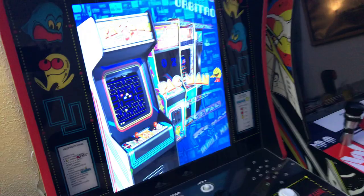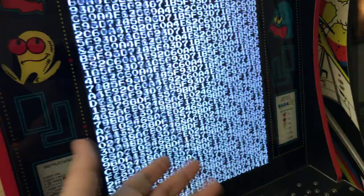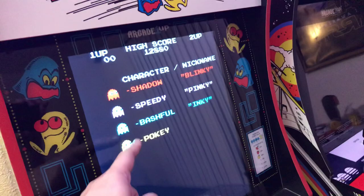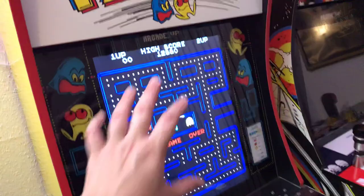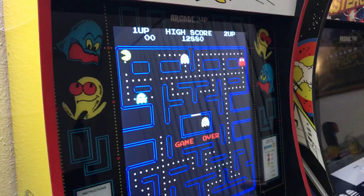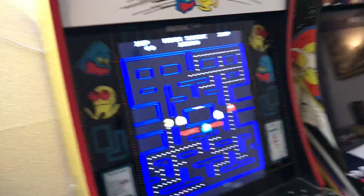Let me get focused — so if I come out here, there's the RetroPie. I'm using a vertical arcade set that you can find on Arcade Punks. It's specifically set up for vertical games from the get-go. One thing I'll warn you about — my monitor was upside down when I tried it out, and I tried a lot of things in software to flip it, but there kept being so many little places where it was still messed up. So I actually wiped it, started over with the same image, and physically took the monitor out and flipped it over.